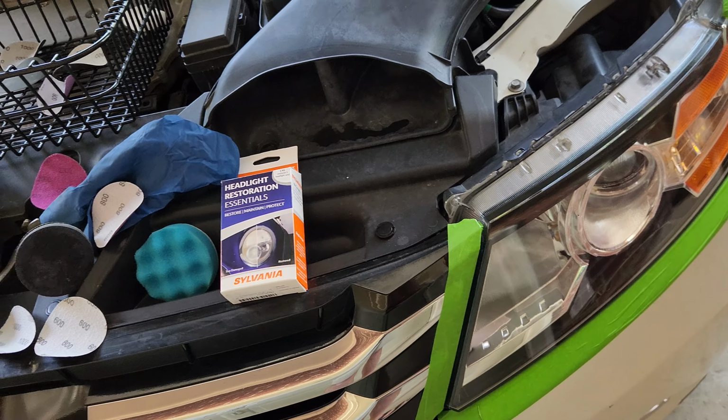compound that the full kit also comes with, it's kind of like Triple E compound, rusty, muddy colored, I use this PlastX buffing paste with the hook and loop and this foam pad, dampened with water, and buffed both. Rinsed again, soap and water, let dry, and then the final application was the activator again, because that's the procedure of this. Do the activator one last time, rinse and dry, then you apply the clear coat.